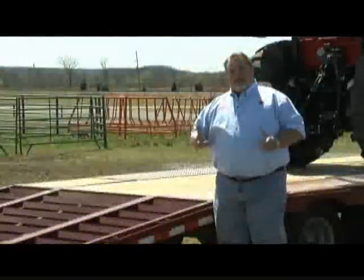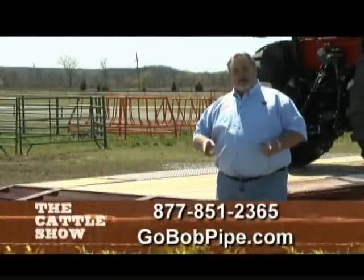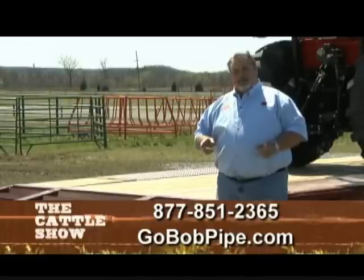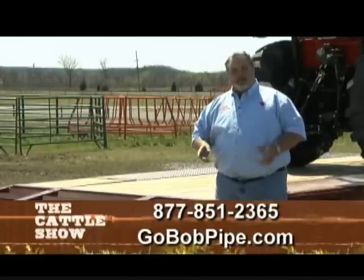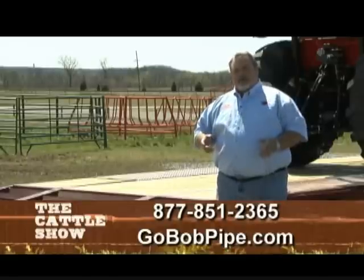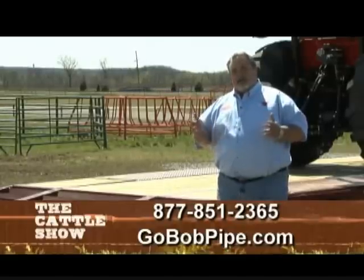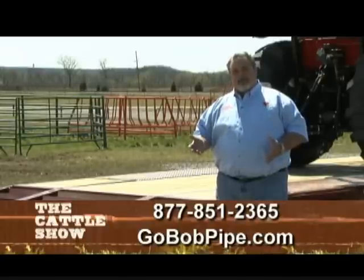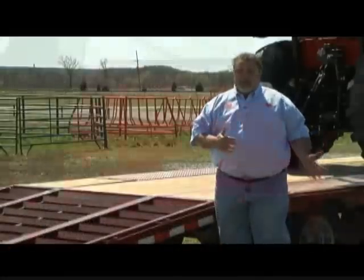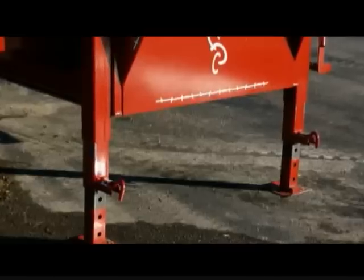Let me summarize it like this. When you're looking for a flatbed trailer, first make sure it's properly engineered to protect those main beams. The boards, tires, and couplers can all be replaced — but if your main beams develop metal fatigue, your trailer is not worth anything, and it should last you a lifetime. Once you've determined that, look for the other features: the oversize toolbox, the side steps, the spring-loaded pads — things that are going to make your life easier.